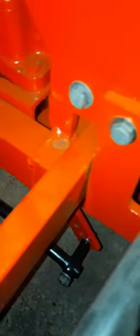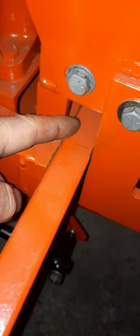So what did I do? Well, the first thing I did was figure out how much play this front axle had — it's an inch and an eighth of play between here. Then I wanted to see the maximum height I could raise this plow. The maximum height with it all the way up, with the modification, is eight inches now. Before that it was five inches, and I don't even think it was that because of the way the hydraulic system is set up. So I know I gained three inches for sure, and I gained on the lift on the back as well.